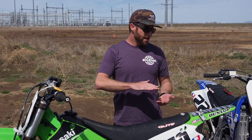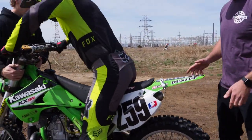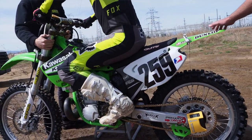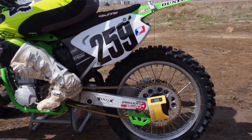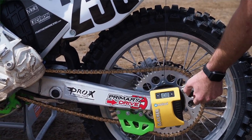So 103 is our baseline, but this is a variable we can change. If he's wanting more high-speed straight-line stability, we might drop that down to 105. And if he wants a little less sag for better cornering or more precise front-end feel, we might change that within a couple millimeters — drop it to 101 instead of 103.